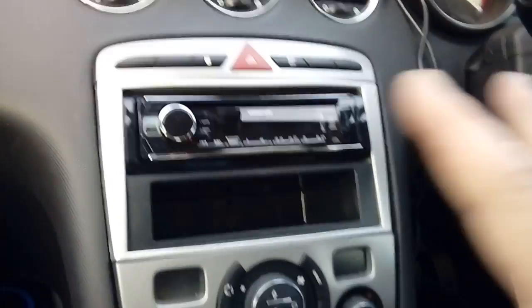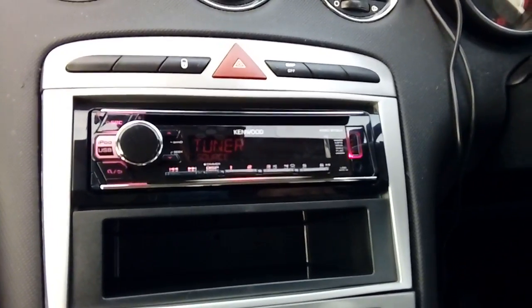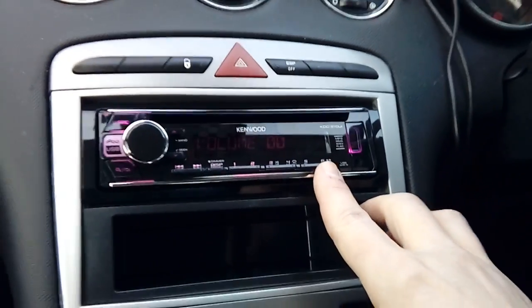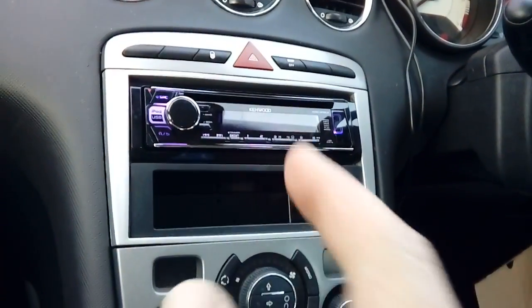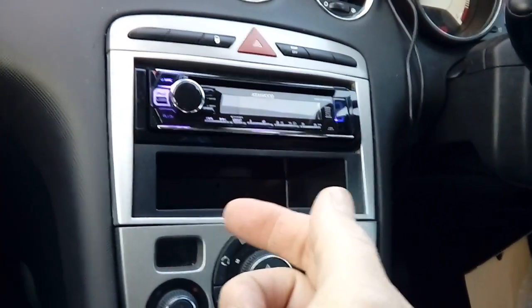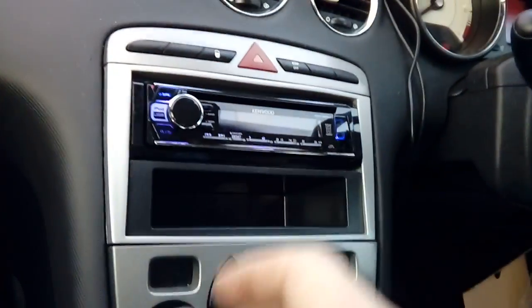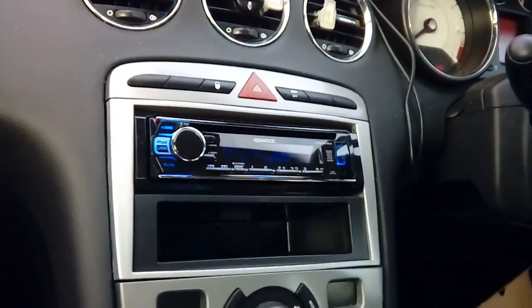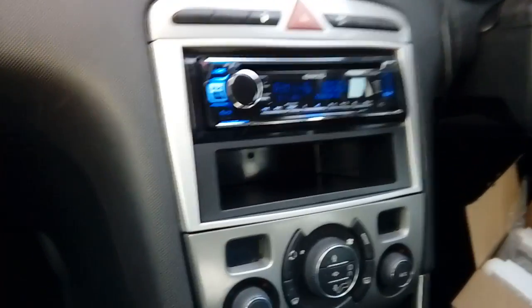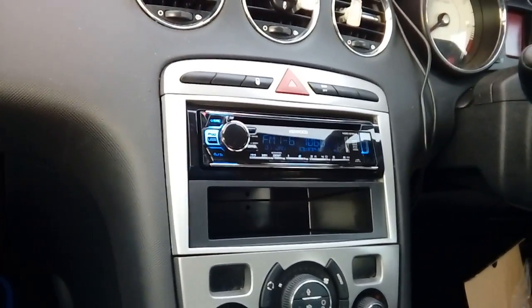Put your pocket in as well and then we get to test the radio. All you've got to do now is put your ignition on and make sure it remembers a radio station — which, if you followed this guide correctly, it will do. We have a radio station — just turn it down — tuned in on number six just to test it. Turn your ignition off and on again just to make absolutely certain. If for some reason it's not remembering radio stations, the little loom that comes with the radio has a red and yellow wire with bullet connectors — just pull them apart and switch them so red goes to yellow and yellow goes to red. If you've got the correct wiring harness adapter shown in this video, it's just plug and play. That is how to fit a radio on a 2008 Peugeot 308 — it also covers all the years this model was made. Pop any questions in the comments below. Thank you very much for watching and goodbye for now.